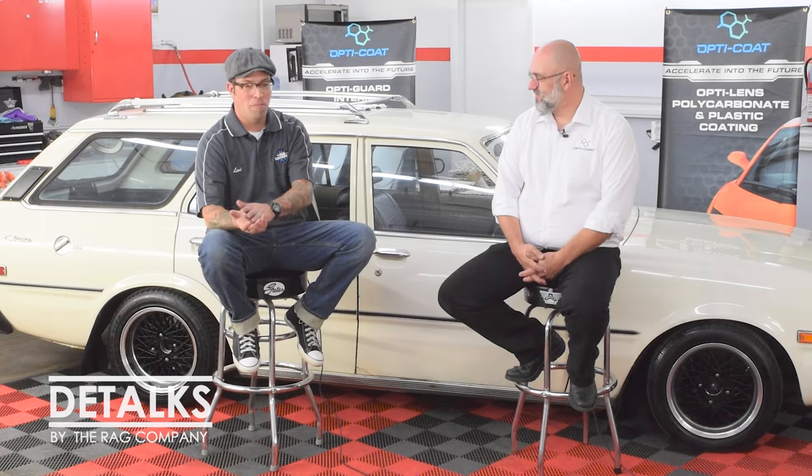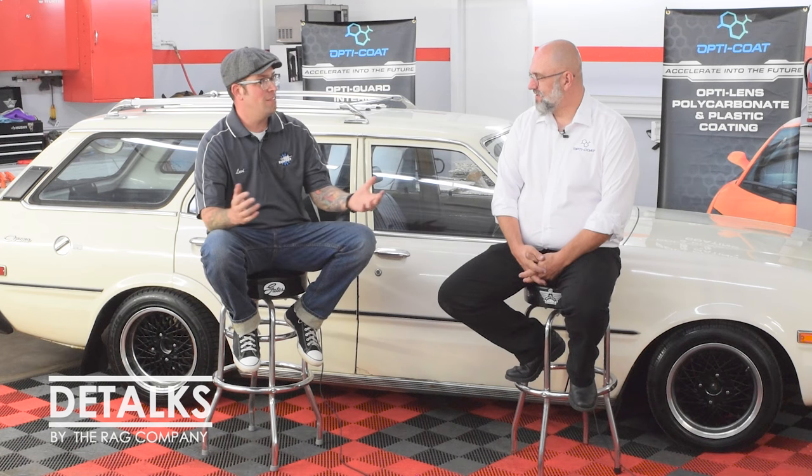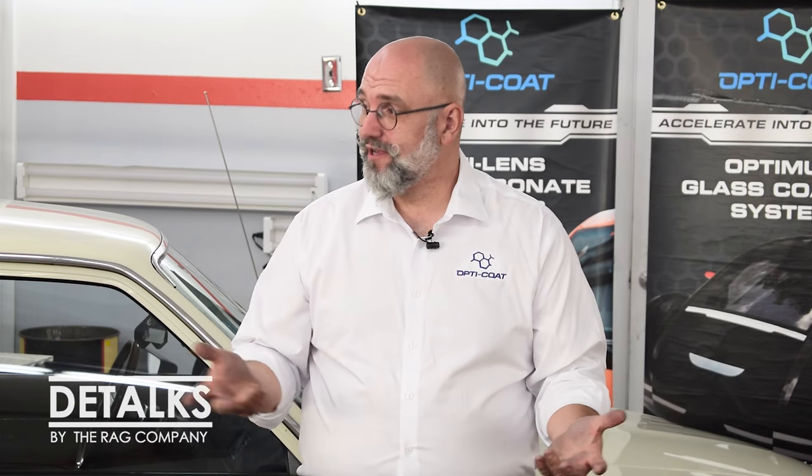And even, you came in and you've taught my crew how to do it as well and use the DA a different way, and that was something that blew all of our minds. We came in thinking, oh, we're doing it just fine. And we have good correction and good looking cars coming out. Ivan came in, showed us some little tips and tricks and ways to do it. We did a thermal imaging camera, and it's amazing the difference in pressure. You don't realize how much heat you can create by doing something as menial as putting your hand on top of the machine when you're polishing, whether it be a rotary or a DA.